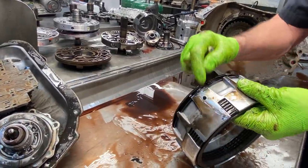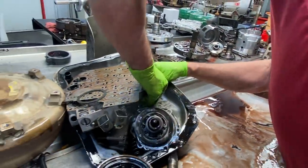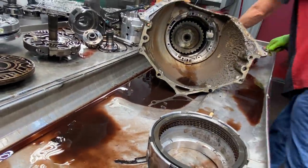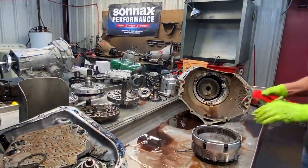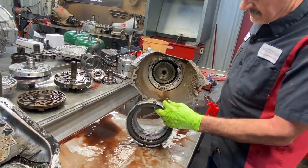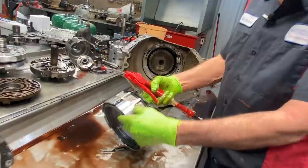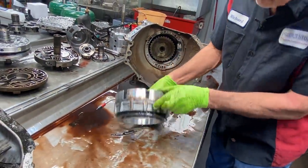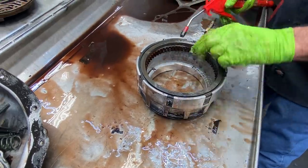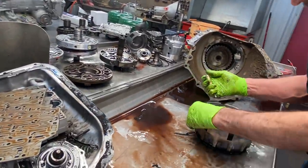We have our overdrive clutch here — this is where our center support bolt went through. You can screw that in there and grab an air blower to check it. That bolt is hollow and that's what it does. We have a little bleed orifice over here — that's why it's bleeding off. If I plug that up right there it should hold pressure. So you want to always check that — once you put new seals in this, you can air check it back and make sure it doesn't leak.